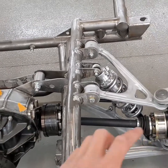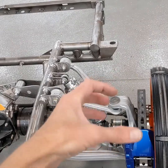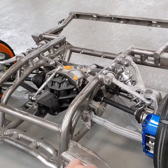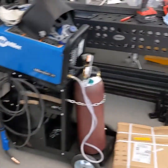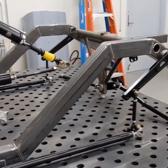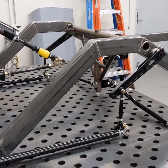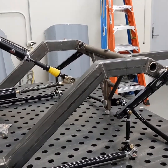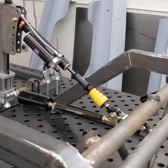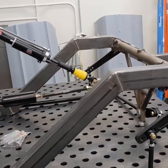With IRS you can't really twist the suspension forwards or backwards. IRS is really great for the street and good for rough roads, but ultimately on a relatively smooth race surface the decoupled three-link is supposed to give you better handling and more predictable grip than IRS. I've never run one of these before, so this will be a first time for me — I'm learning, you're learning, and it's going to be pretty cool to see it come to life.